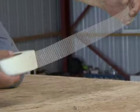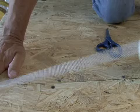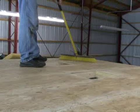It's a good idea to use a seam tape for the seams on the roof, especially if they're more than 1/16th of an inch wide, before you put your rubber membrane down. What it does is it covers the seam up and it will cover up the screw heads, so if any of the screw heads are slightly above the decking this will help protect the rubber roofing from the sharp edges.